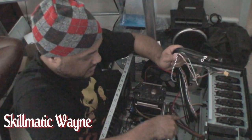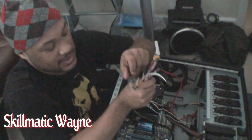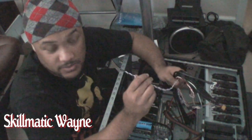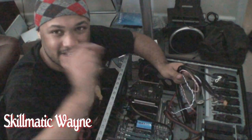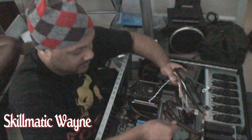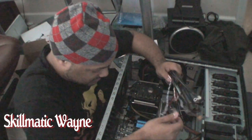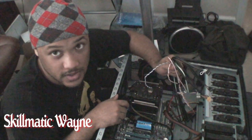The next thing we want to do after we've connected all our ATX wires to our motherboard — there's a bunch of snake wires here. Luckily for this particular motherboard they are color coded. Normally it would say something like 'Reset SW,' that would be the reset switch, and you would need to look down with a magnifying glass or just look down there if you had good eyes. You'd see little small 'Reset SW.' They all have little jumpers and you have to put them in the corresponding holes. But here they've actually color coded it for people who got frustrated. It's color coded, so it's self-explanatory. I'm going to go ahead and get these all connected before we put in our GTX 285.